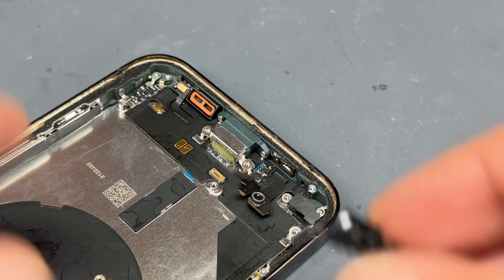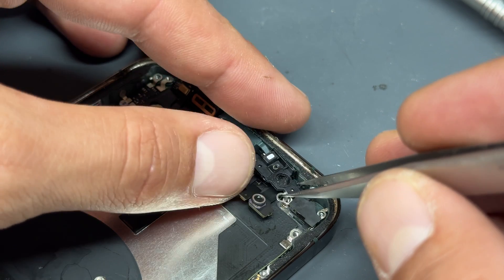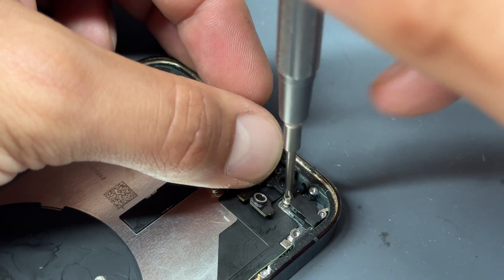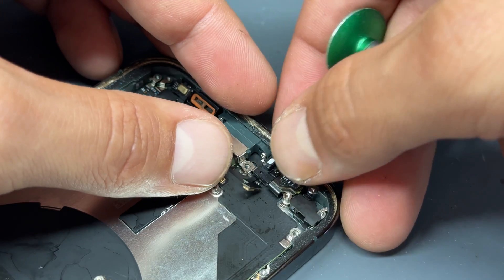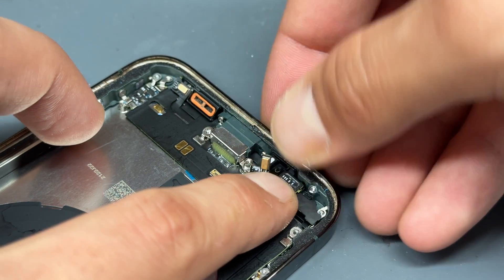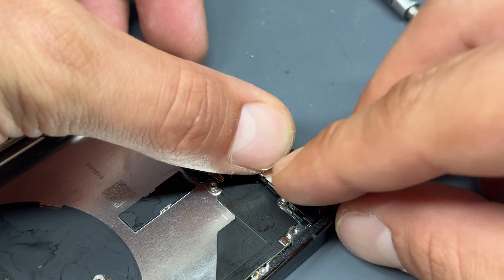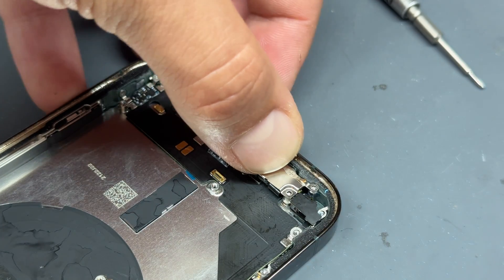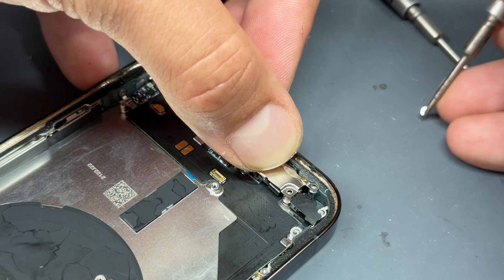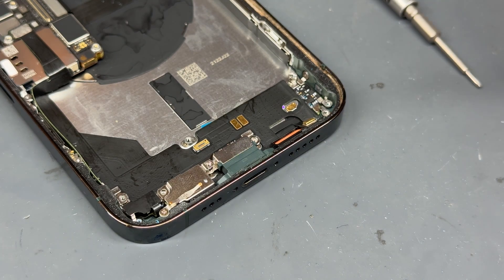Now we've got the little plastic clip to go in place — there's a little point on it that sits into a small hole on the chassis. Get that in, and it's held down by a standoff screw. Then push the barometer sensor down — actually, put the standoff screw in first. Push them down a little bit and line up that little metal shield. Apply pressure on the shield so the springy microphone and barometer don't pop up, and get it secured down with one crosshead screw.